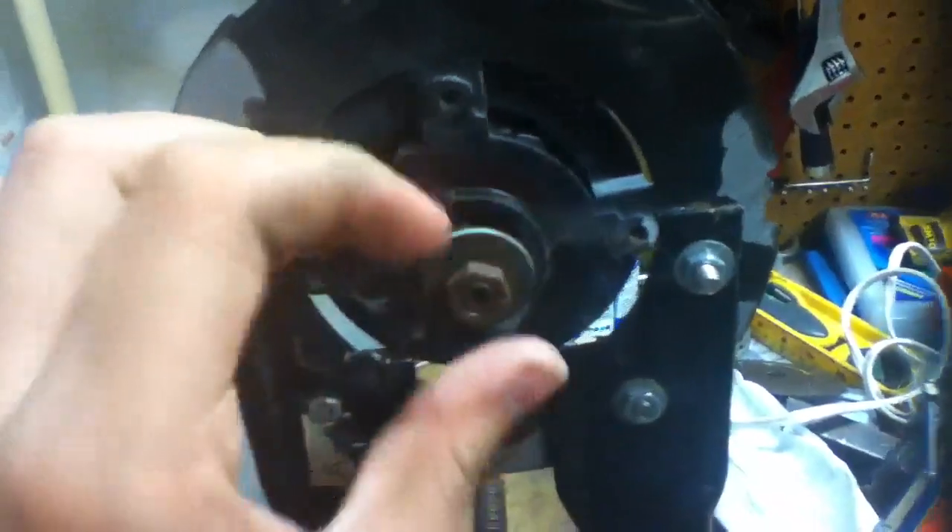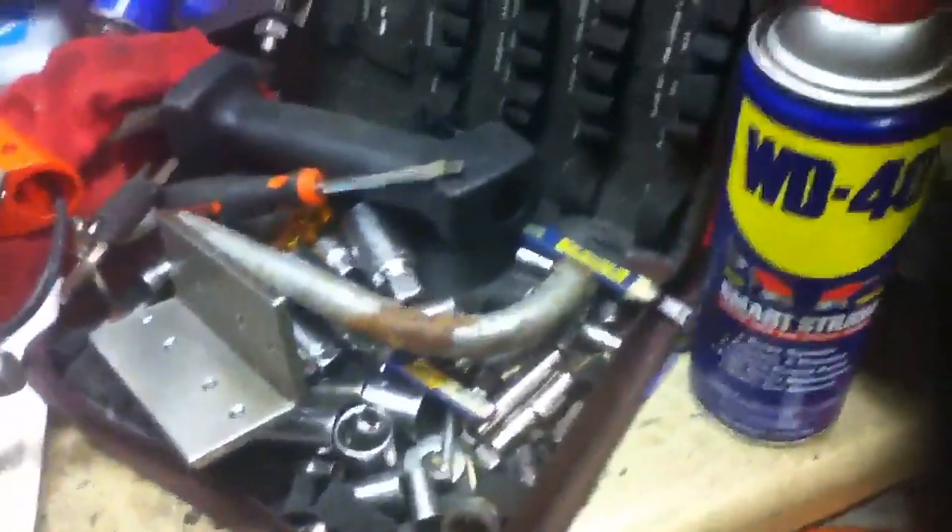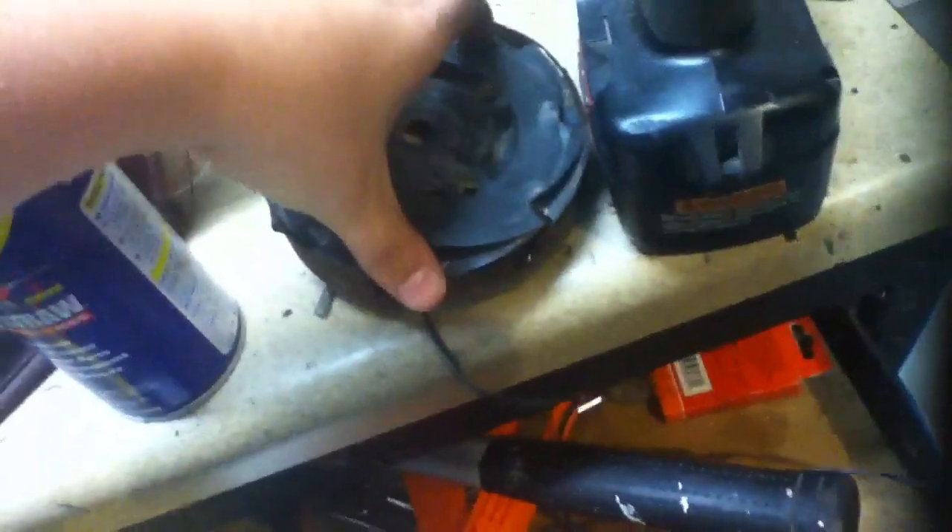This was an old steam cleaner slash carpet cleaner. The motor was really loud and it was seized when we got it — the bearing would squeal and scream. But I think I'm going to have a use for it; it's overwhelmingly powerful. It used to have a pulley on one side and an impeller mechanism on the other, and I tried to keep it all together so I could always put it on another motor if I ever needed a nice vacuum cleaner motor.